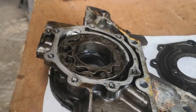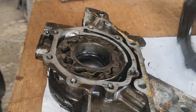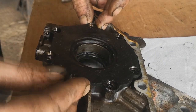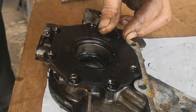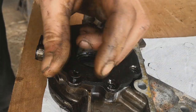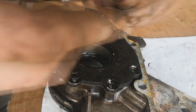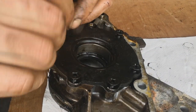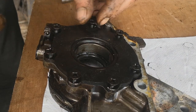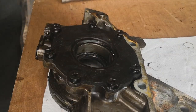That's why people put crank collars on, and what the crank collars do, you shrink them on and they give you 100% contact. And it's a similar situation to the long nose, short nose crank problem with the MX-5 engine. If you get a tiny bit of movement, over time that movement becomes larger movement, resulting in failure.